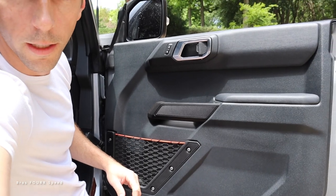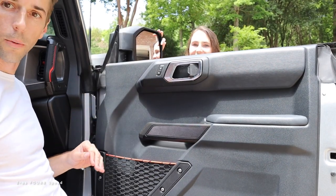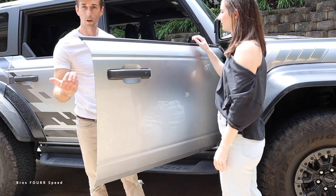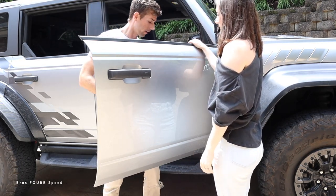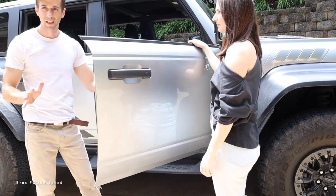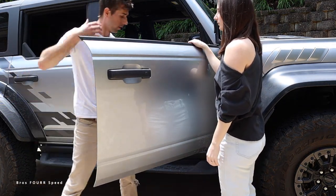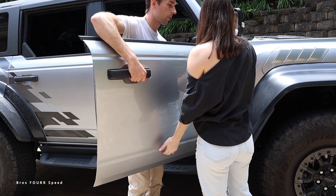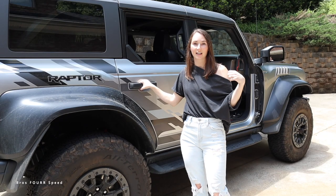With the bolts out, the next step is to move the side mirror — just pull it towards you so it's out of the way. Then there's a lift handle. I wouldn't use the grab handle inside to take the door off; use the outside handle instead. The inside handle is a little flimsy for this purpose. With the mirror out of the way, we just lift straight up and off — and that's door number one! It maybe took 20 seconds and it wasn't heavy at all.